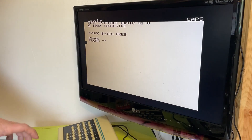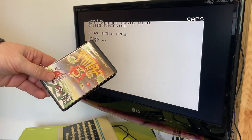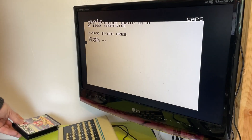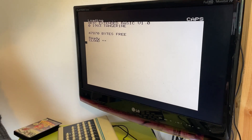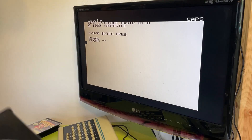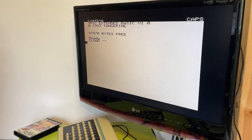We might have some success — Probe 3 might not be lost in space after all, it might be recoverable. It's actually loading off the original tape. I did modify one of the settings — there's a setting in this application for synchro length that was set to 8 bytes; I've put it up to 128 bytes so that it's a longer warble for it to lock on. I'm not sure whether that's made a difference particularly, but it seems happy now.